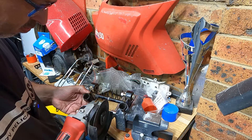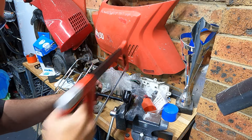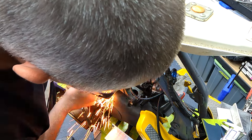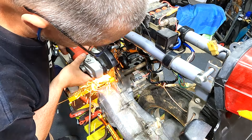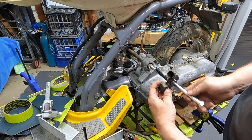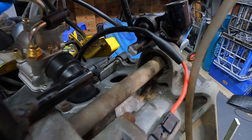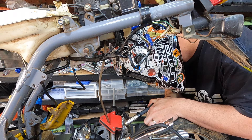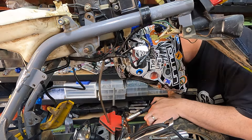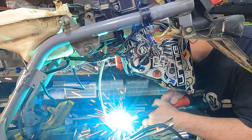We'll pull this apart, take this little engine mount out, cut it in half, and make it fit this motor. Given that the Yamaha Pesola is so narrow — much narrower than the 3KJ Jog engine itself — I had to take half an inch off each side of the engine mount tubes. I needed to do this to keep the engine mounts as narrow as possible in order to give the best chance I can to get those fairings to fit without bulging. Welding it this way didn't work; this bracket needs to be 100% in alignment, otherwise it will twist itself apart.